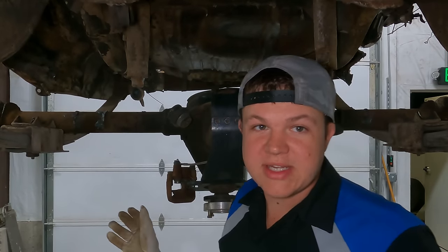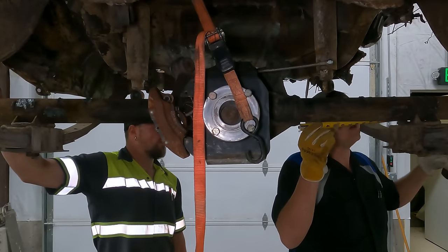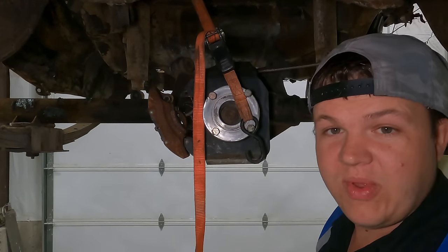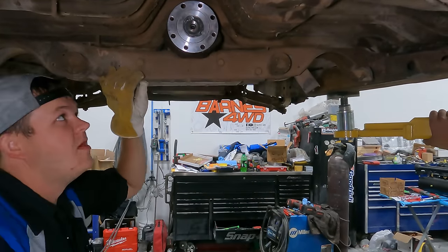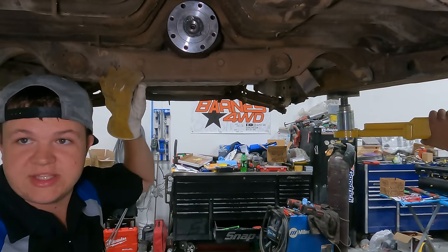All right, so I went ahead and lifted this up in here. Hillbilly just watched me get it taken care of. Yeah, I watched. We're gonna measure it, figure out where our perches need to go, and then we're gonna weld it. We're not gonna weld it yet. We wanna get the angle of the tail shaft and this angle the exact same. So our next plan, we gotta drill and tap the output shaft for this bolt-on yoke so that we can get the drive line put in.